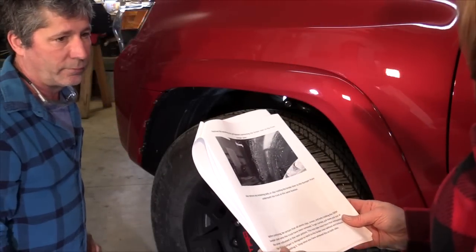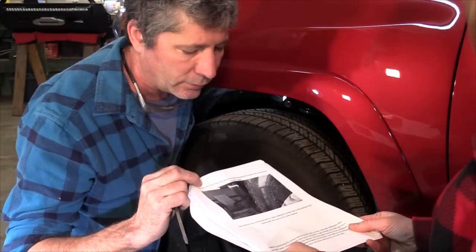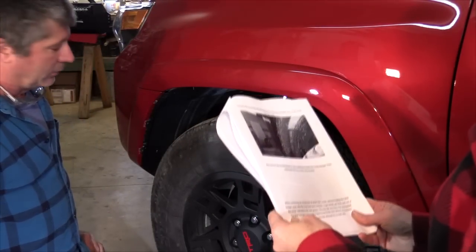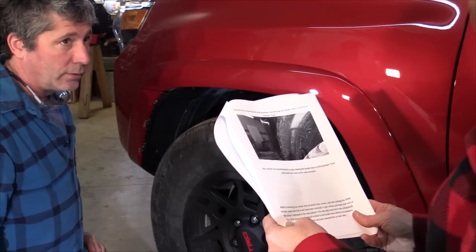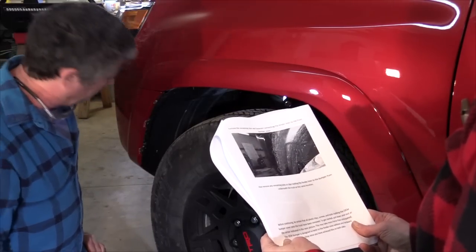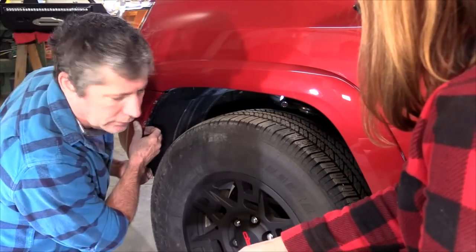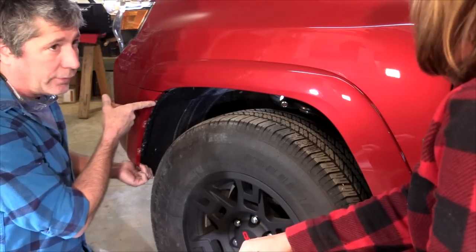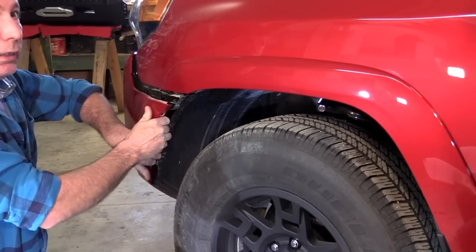To get started, pull down and out at the corner indicated in the next picture. This may take more force than anticipated. The OEM bumper is designed to latch to the fender even without any hardware holding it. Stop once you have achieved this on both sides. It may help to pry this section from around the screw location. It's located in the wheel well at the circled location. That one. Yes.